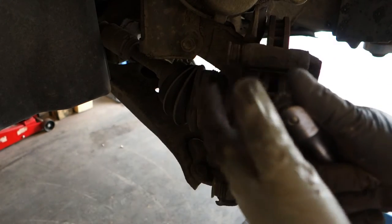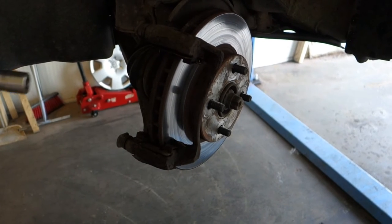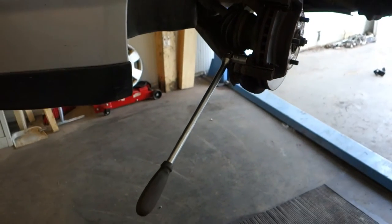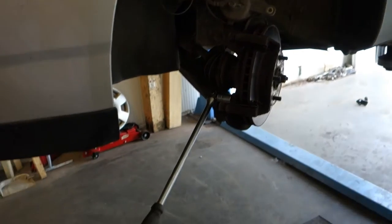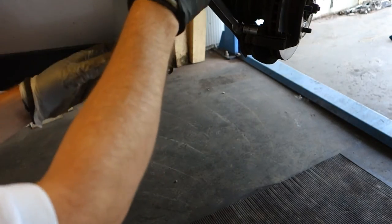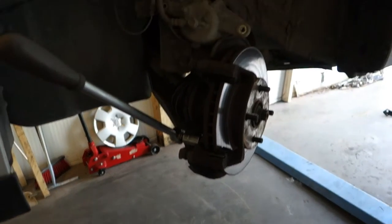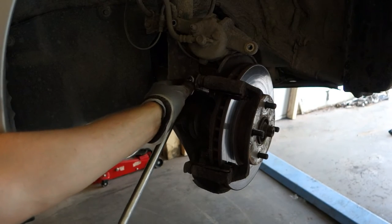And these bolts are tight, and so we need again quite a long bar. I have had this in here for at least 1 week, and this rotation direction is that way, and note that now this disc must be in that kind of position that I can lift that bolt up in that way. Now it opens, because if this disc is in the wrong position in here, I can't rotate this long bar. And then I open also this upper one and I insert that in here.